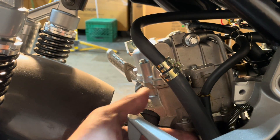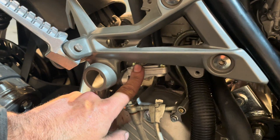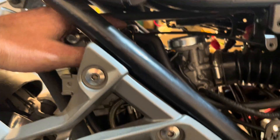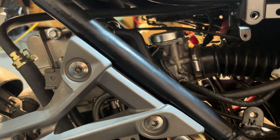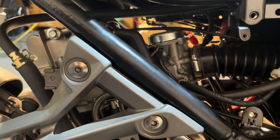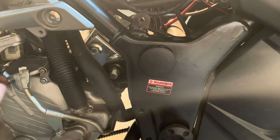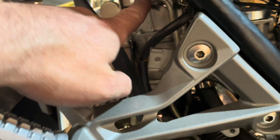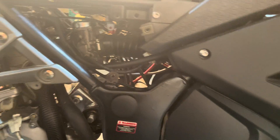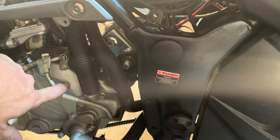This right here that goes up to the air box in the front — this is for your emissions line, and it comes out also off the emission system right here and comes up and around. We're going to go to the other side because there are a lot of vacuum lines there that I'll explain. This here is actually an oil line — it's all steel. It comes up here, joins into this line here, and then goes up straight to the top of the engine. It also goes down to the back of the crank right there — that's an oil cooling line.